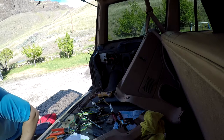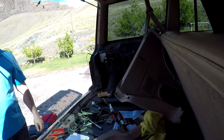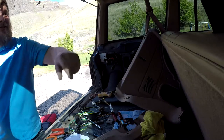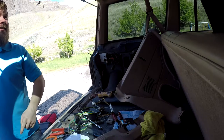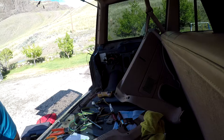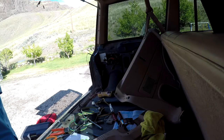You are not gonna believe this. Somewhere at this side, the right side here, actually runs to the front of your Jeep. This side runs to this side of the Jeep. So there's two separate harnesses that I have to tie into. That would kind of make sense why our previous trailer wiring harness didn't have a signal for the right side. That would probably explain a lot. Remember that? Yeah, I remember that. Well, I don't think there's anything wrong with the previous harness. It just didn't have the connection to the right side.